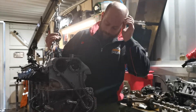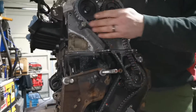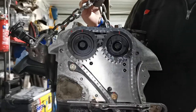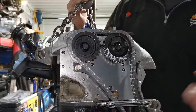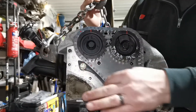There are a couple of ways we've combated this. We spoke to the supplier we got that from — they recommended shaving down the actual guide rail here. Basically you just get a sanding block, those cork ones you use for DIY, and you get different grades of sandpaper and you just smooth it, shave it down a little bit.